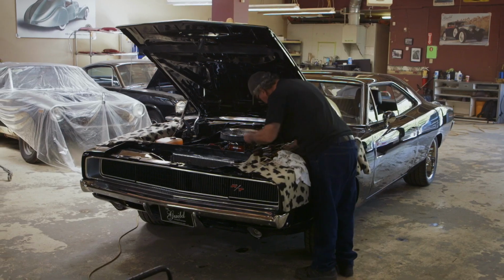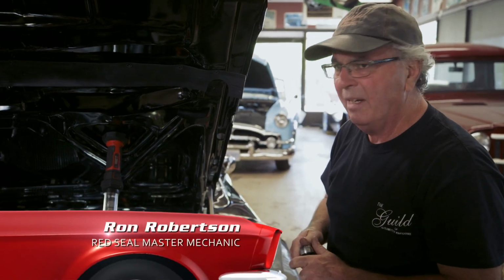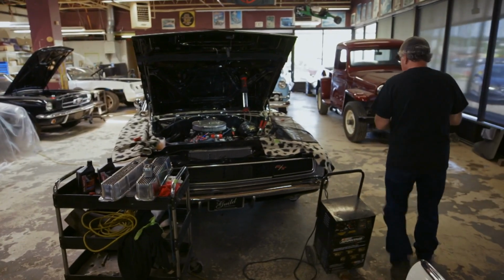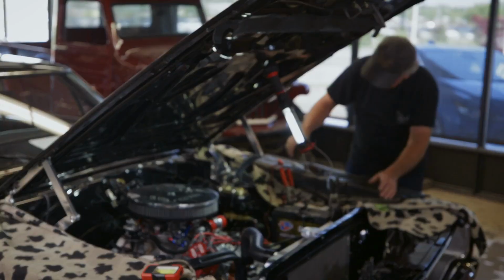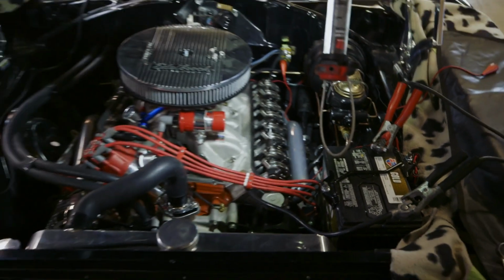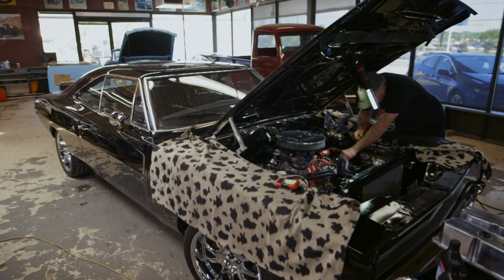After Ron replaced the carburetor and got this thing running, we found that the rockers were ticking pretty bad. And yesterday I had it running outside and a little tick turned into a very large tick. Started up, it sounded like a sewing machine. So I'm just doing a little investigating now and seeing what's going on here. It's an expensive brand new engine, a lot of money spent on this stroker. It's a 500 cubic inch big block Mopar. It's a pretty cool engine.